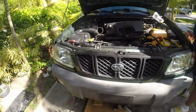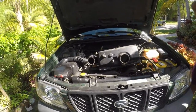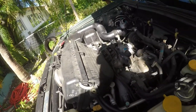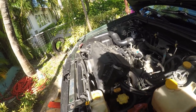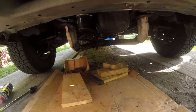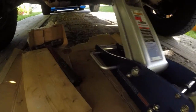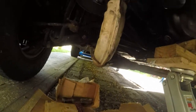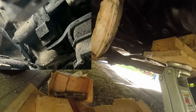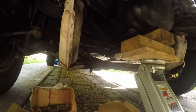This is like a super super sketch job because you kind of have to reach into places where it's kind of dangerous — you could lose your arm. Just wanted to note that guys, this is not recommended for novice car enthusiasts. Do not do this if you're not a professional like us. Don't be like us. Since this is a considerably dangerous job, we're taking the jack stands out and putting the car back down on the ground so it can be level, because the blocks underneath the oil pan to jack it up want to kind of move out. We're gonna try it this way.